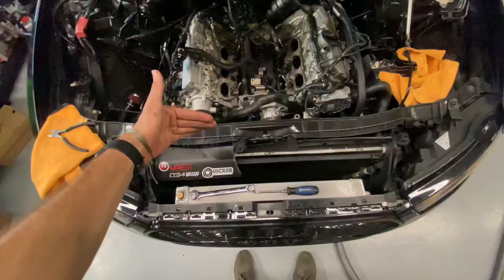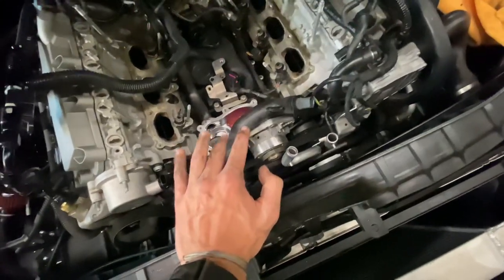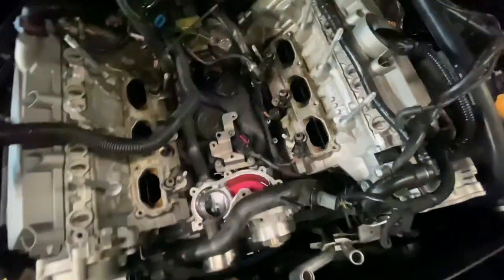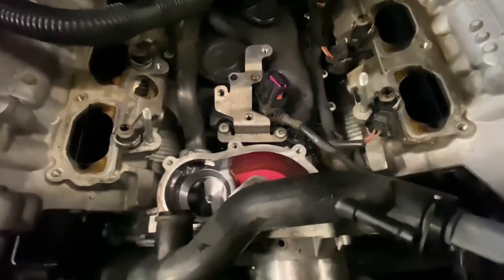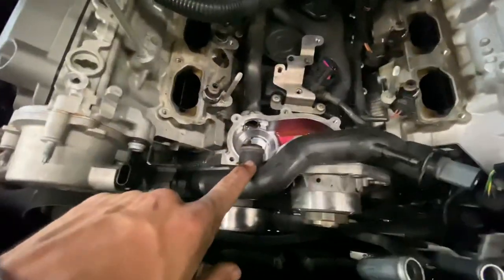Just checking in. I've started to work on the maintenance part of it. I've got the thermostat out. I'm attempting to do this without putting the car in service mode. I've got the pulley off, all the bolts out of the pump. That also means I didn't drain the coolant — once you pull that PCV it dumps coolant everywhere. So I've just been sucking it out with a vacuum, hoping I can keep sucking it out instead of having to get under and drain it. Am I lazy? Absolutely. Very important when pulling this tube back — right next to this connection there is a T25 bolt. Do not forget it or you will break this. Learned that from FCP Euro's video.